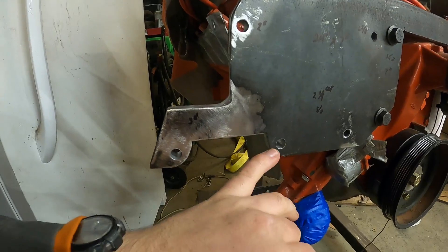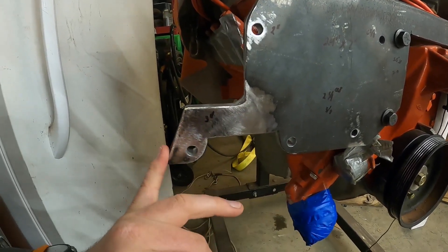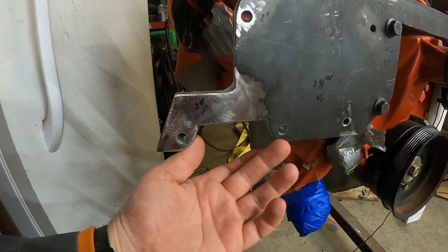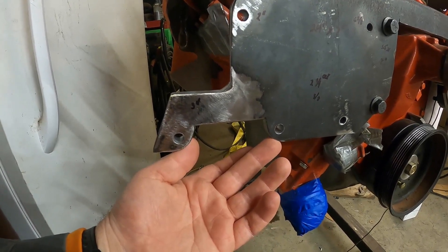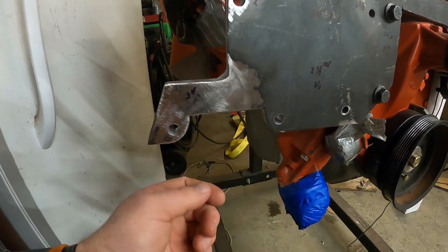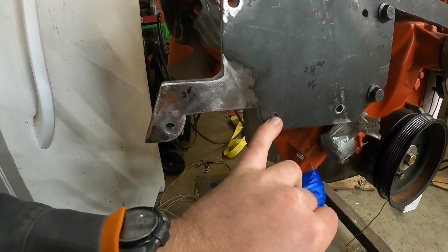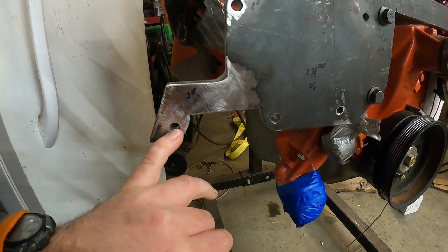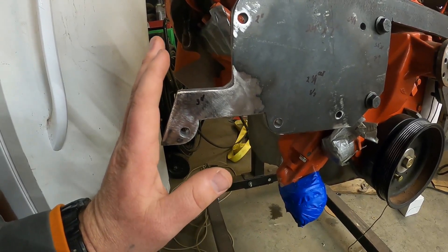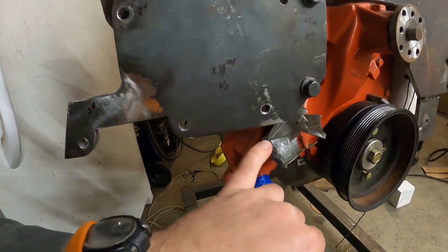Down here for my air conditioning pump, this actually comes out 3 inches and it was one solid piece. On that previous video I made a template from a Sanden-style pump — I think it's a 508, I'll look it up and put it in the description. I made that template, got this bolt started, cut it out, and hopefully when this goes into my Firebird I won't have to move it.